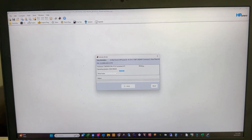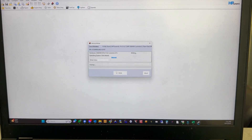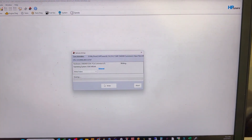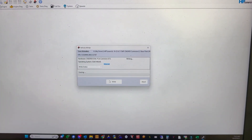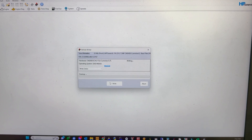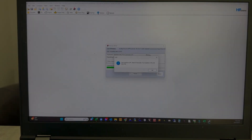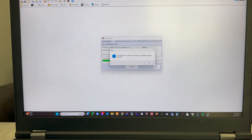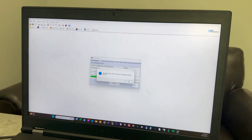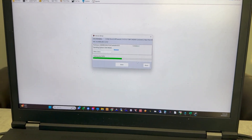And then we're going to Write. It goes through the unlocking, gathering, erasing, all that stuff. This is putting the stock file in. Since this is a PCM swap, we're taking the stock file that we read out of the truck and putting it in this new ECM with the securities and the VIN number from the original ECM. As soon as this gives you a percentage, that's what you're waiting for. About 7 minutes and 49 seconds. This just wrapped up — it says turn ignition off, wait 10 seconds, turn ignition on, and click OK. Turn the key off, wait 10 seconds, back on, and OK. Completed.